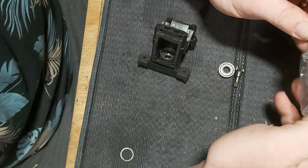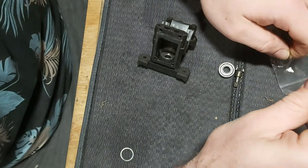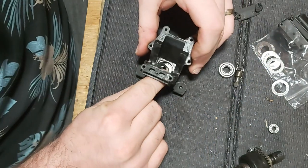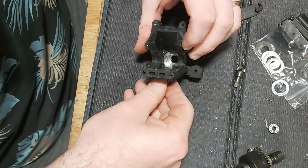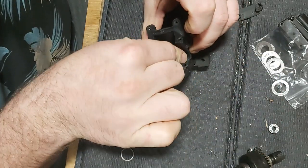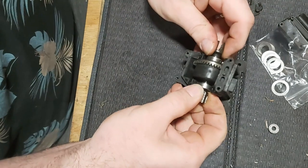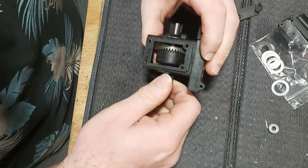I want to take up about 0.4mm, so I'm going to put two of these shims in. Because the gap is between 0.6 and 0.7mm, I still want a small amount of clearance — I don't want it to rub. The two shims drop in quite nicely behind the bearing — they're a perfect size — then the bearing goes in, then the pinion, and then the diff.